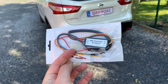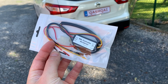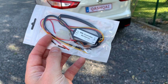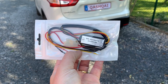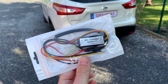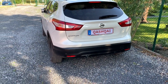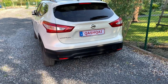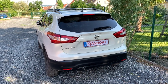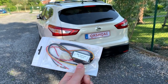When this module is powered it will power your tail light. When you shut down the power source, this little module will keep your tail light live for about 15 seconds — quite a nice solution. If you wire the turn light as well, the tail light will go off when you indicate. But to install this you still need to find a solution to wire up all the cabling. Tigrimang figured out if he could install this module directly in the trunk, wired up to the wiper motor — but not a chance. The wiper motor only generates 9 volts, not enough to power the module. So that module was quite worthless for this purpose.